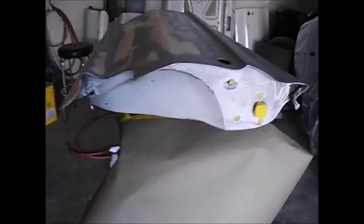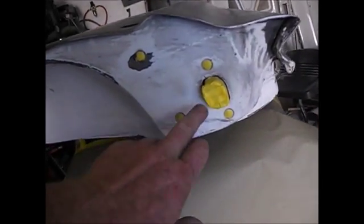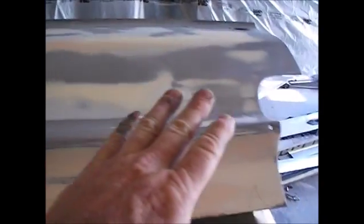We're going to get in here and get this door down and go ahead and scuff up the jamb and stuff, and get it ready for primer. So there. Alright. Got the jambs all cleaned up, scuffed down. I scuffed them down at 150, of course masked off a couple little things I don't want to get anything on. Top of it's cleaned off with rubbing alcohol really good, and I'm letting that stuff dry. This door's really turned out pretty nice. I mean, that thing's going to be straight as an arrow.